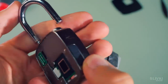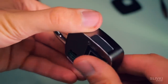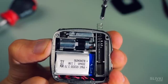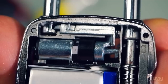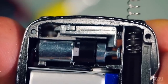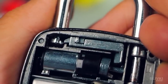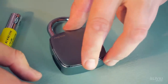This is some real magic. Let's see how the opening happens. After you put your finger on it, the chip powers the engine, it turns, pulls the latch which holds the bracket, and the spring which pushes the bracket from the other side pushes it out and the lock opens. Of course this lock is not designed to resist strong physical force, but I used it on a locker for several years and no one broke into it. Since the lock fixed itself, we're putting it back together and will continue to use it.